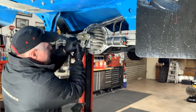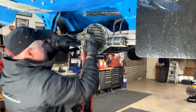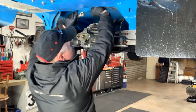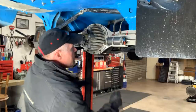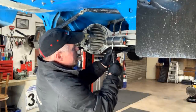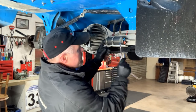The watch link is the first thing to come off. We can go off this end or that end or both ends. I'm going to just do it like this and then get it up and over the two watch link arms out of the way. My remote canisters with the suspension are on here and they get slightly in the way, so we have to loosen them. Let's get that pushed back from the diff cover.